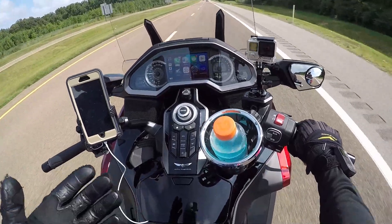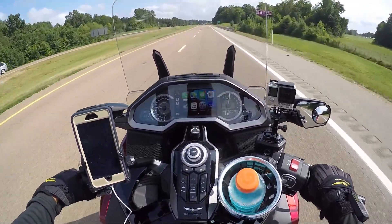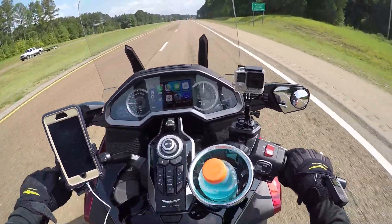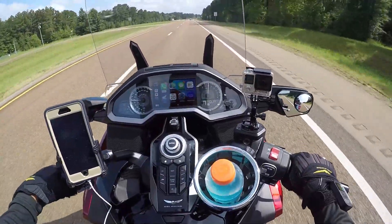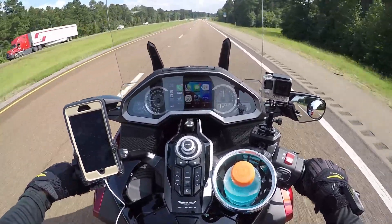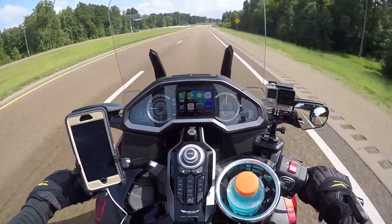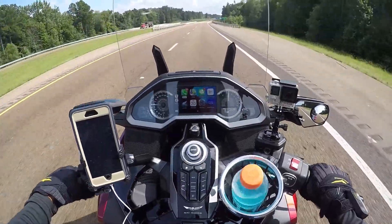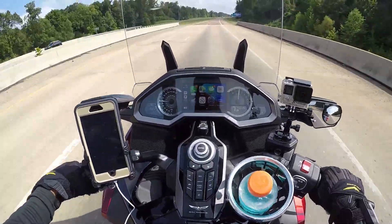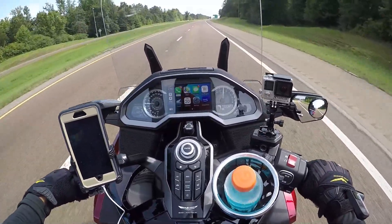As you can see, I'm out here on the Goldwing now. I know the Goldwing is charging because when I hooked up my multimeter, it was showing proper voltage as it was charging from the alternator. For the life of me, I don't know why it's saying the battery is bad. Being that it's a brand new bike, there's a possibility the battery had been sitting for a long period of time. There's also a possibility the battery has a bad cell or is allowing overcharge. But according to my battery analyzer, it says the battery is bad.